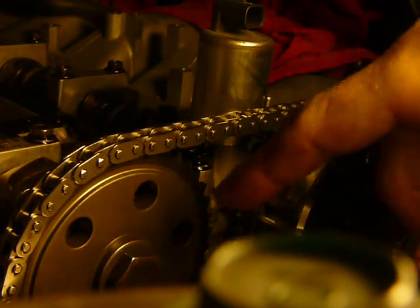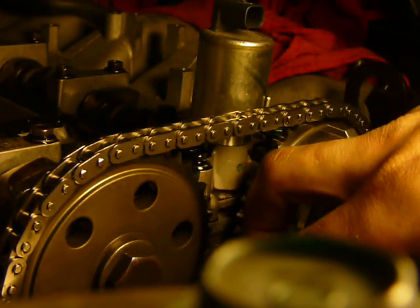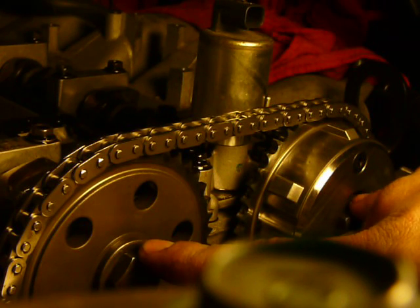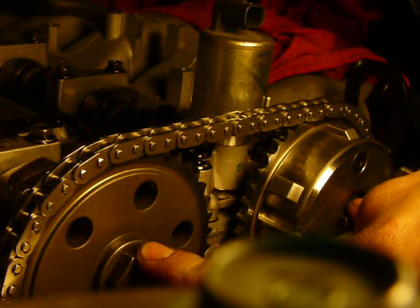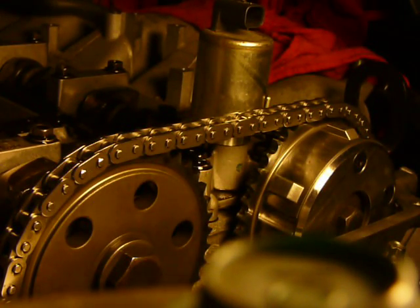I had loosened both the intake and exhaust cams, put the new VVT on, and actually torqued them both down and pulled the pin on the chain tensioner. But when I was cycling it through checking for valve clearance and chain tension, I kind of reached down and pushed on the tensioner arm, and the tensioner clicked out another click.